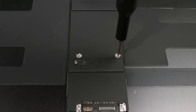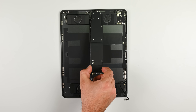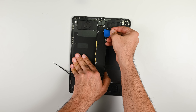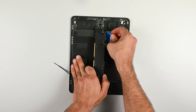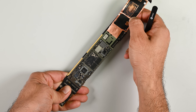The logic board looks to be the same removal process as the iPad Pro M4. A few screws and a couple of sections of cowling need to come away to reveal press connectors and coax cables, plus the occasional bit of tape to remove. Rumor has it that next year's logic board will trade this simple copper sheet for an actual vapor chamber, which means the iPad Pros are getting the same thermal upgrade we found in the iPhone 17 Pro and Pro Max.